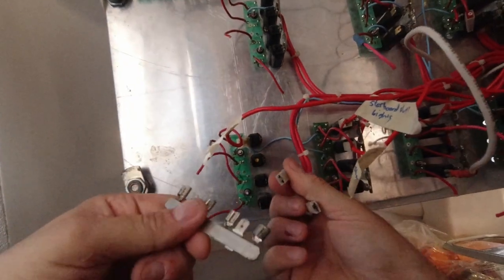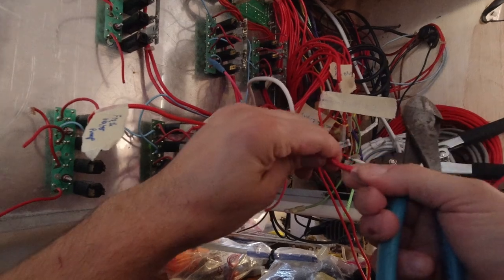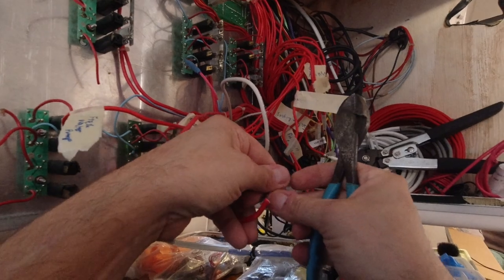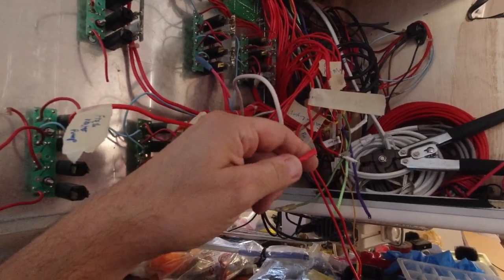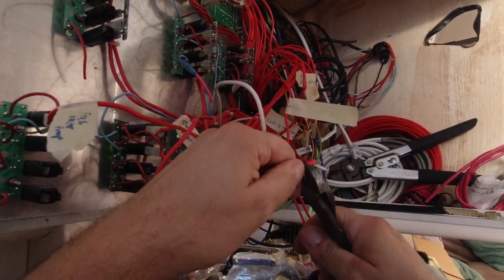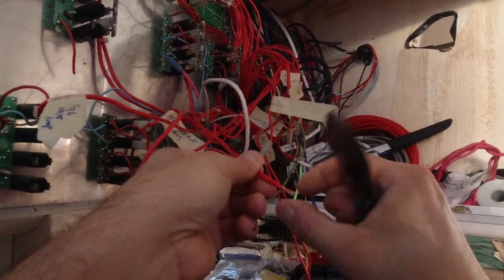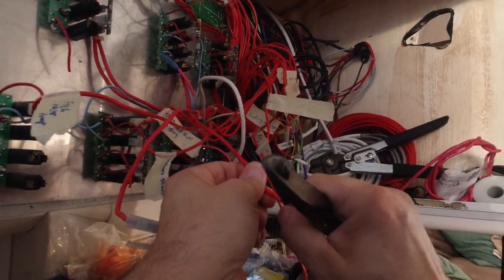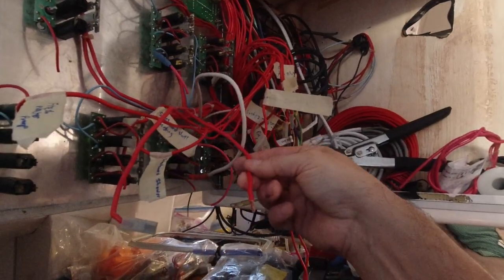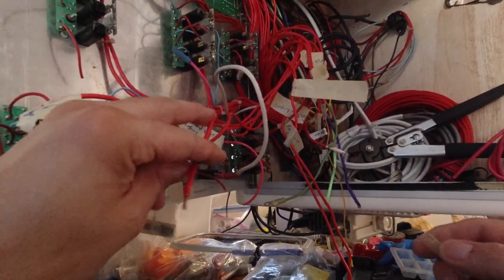I've got two hot lines there. Something else really interesting: none of these wires are tinned copper — none of them. That's funny because this boat was built in 1996, and you'd think that if corrosion was going to be a problem it would have settled in here somewhere, but it hasn't. There's no corrosion anywhere. So we are not replacing these wires — I don't know if they're some other copper alloy, but they are fine.